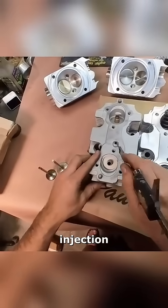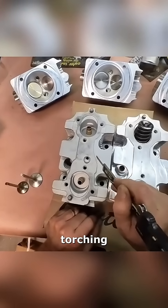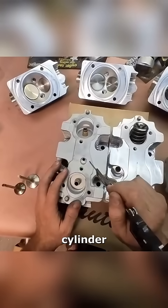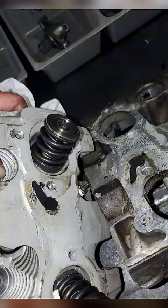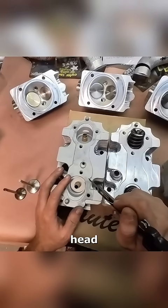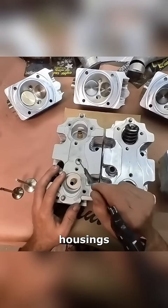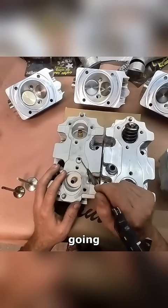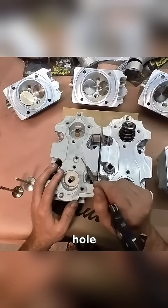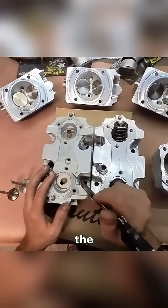The secondary air injection port has a nasty habit on turbo heads of blowing or torching out the seal. This cylinder head is fine, I'm not seeing that at all, but I've seen too many of these cylinder heads with this torched out and they've got this crazy exhaust leak — or it sounds like you've blown a cylinder head and a liner out. You take it apart and that's all fine. You pull the heads off the cam housings and this secondary air injection port, because the exhaust pressure and temperature going down through there, has torched a hole out through the side of this thing and created a nasty exhaust leak that's damaging the cylinder head.